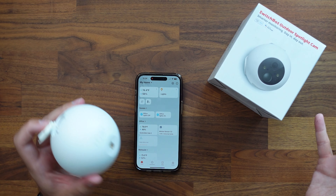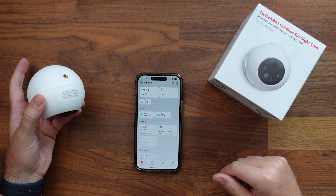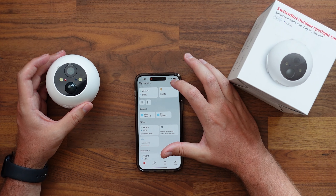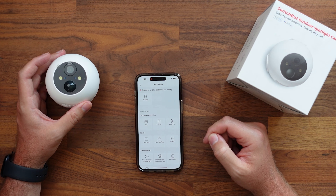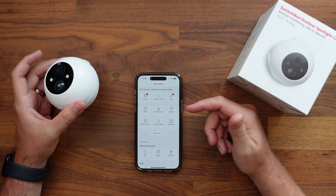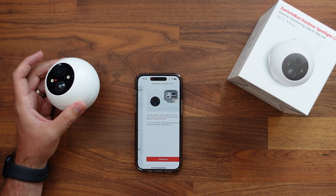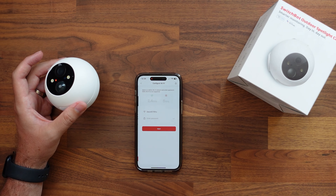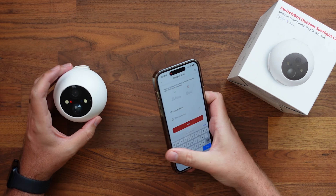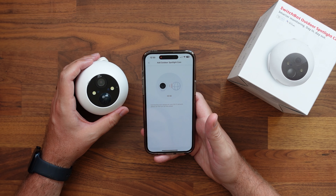Setting this camera up is pretty easy. I've got the app already loaded up, and I'm just going to flip the power switch on. I'll set it right next to my phone — we've got a red light on the front. I'm going to click the plus sign on the phone and say add a device. It's scanning for Bluetooth devices. It didn't automatically pop up, so I found it listed below as 'Outdoor Spotlight Camera' and clicked on it. It does not support 5 GHz network, so we connect to the 2.4 GHz. I typed in my password, and my light has switched from red to green — once the wireless connection is complete, we're all done.